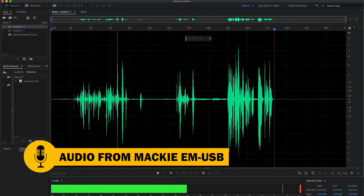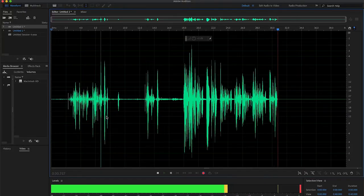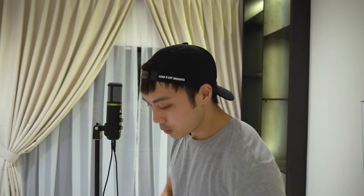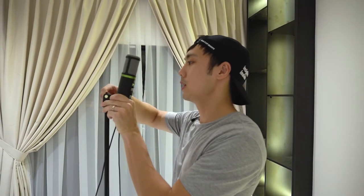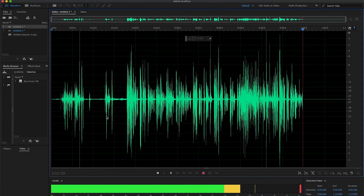You're listening to my voice right now through the microphone. Although you can plug in a headphone into the microphone, you cannot actually do direct monitoring from the headphones — so I'm not listening to my own voice right now. The headphones are for you to listen to the output from your computer. Next, I'm going to record a violin with the microphone and let you hear how it sounds. I'm going to raise the mic up a little bit and tilt it down, and because the LED doesn't tell me the volume, I'll watch my computer gains as I do this.